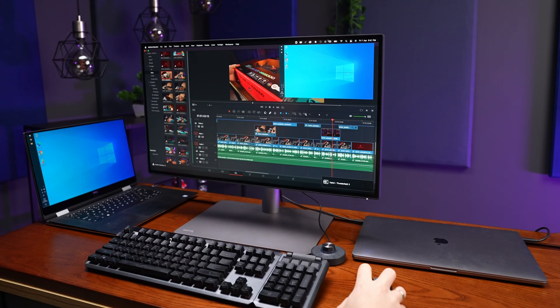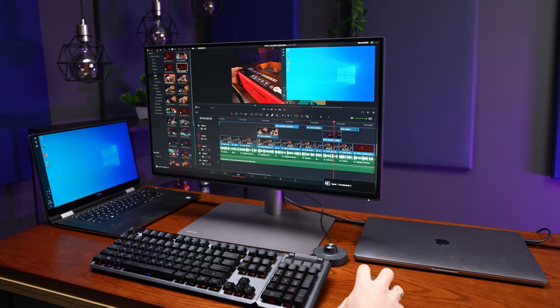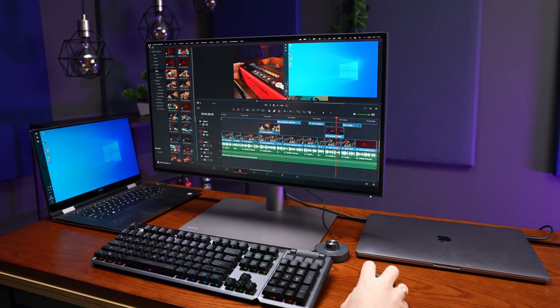On the other hand, if you're using the drive in a video editing PC where it's being used for caching, the amount of data written may be considerably more. For example, in our editing workstation, this NVMe drive collected over 100TB written in just over two years, and we only recently started working with larger project files. With this in mind, the Asus drive is rated to handle 1400TB of writes, which even in heavy use will likely outlast the drive technology.